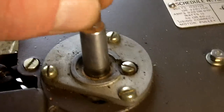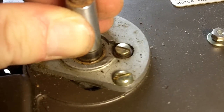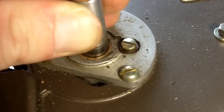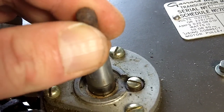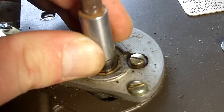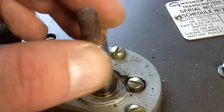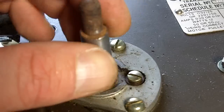Most importantly, check for play here in the spindle. Really move it about. You can feel this rocking. That means good new bushes at the very minimum, through to potentially, in this case because of corrosion, a new spindle. And just new bushes alone, you know, if you can find someone who's able to do that job for you, I would suggest that's looking at least £100, and I can imagine, well, to faithfully recreate the spindle would be a very expensive task indeed.